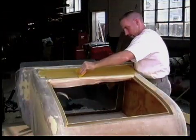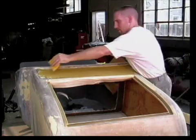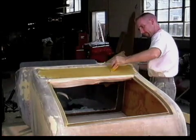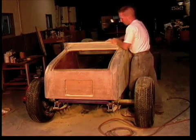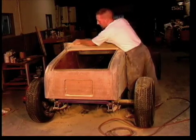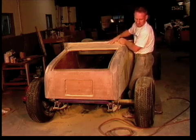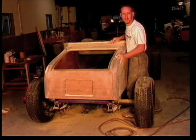Rarely can everything be filled perfectly the first time. Sanding usually exposes areas that are wavy or just need more filler. Long skim coats can remove the final trouble spots. Finishing up the sanding, the last few contours here where it all meets the body. You can see everything's got a good overall surface finish, and I'm going to move on to priming with the Duratec surfacing primer.